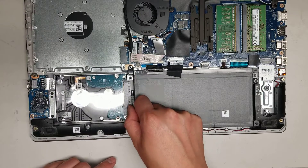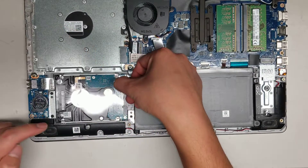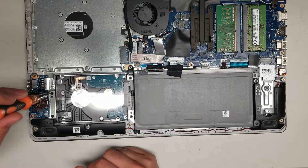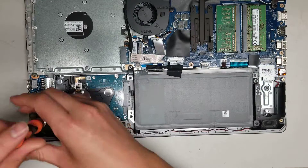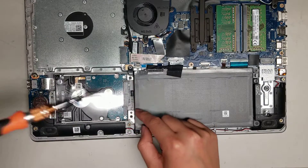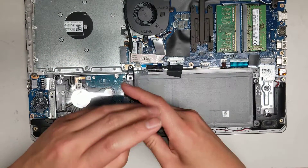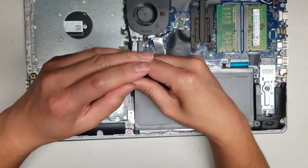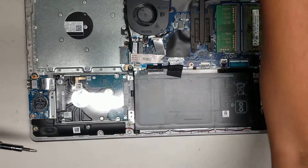To undo the hard drive connector, use your fingernail or a pry tool, move it back a little, get a gap, and slide your fingernail in to pry it out. I'm going to put an SSD in here since it's running super slow, so I'll show how to remove the hard drive. Remove the two screws — actually there are four screws total holding the hard drive in place. Unfortunately, someone previously tried to open it and stripped a screw, making it difficult to remove. Make sure to put a lot of pressure when working with screws — I'm going to have to replace that stripped one.